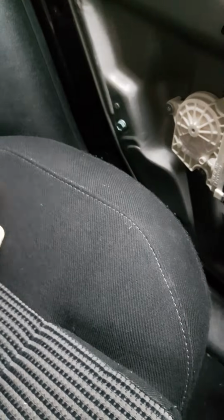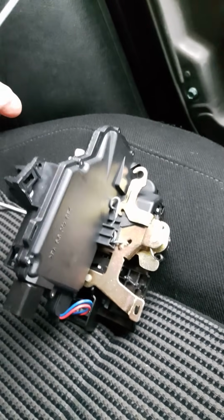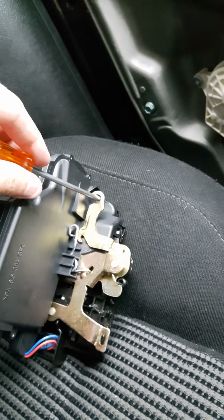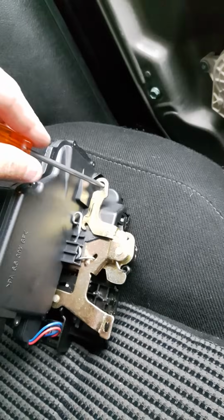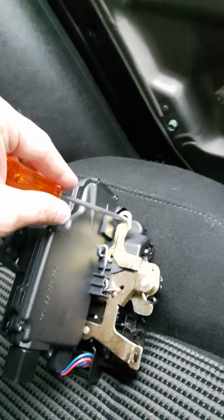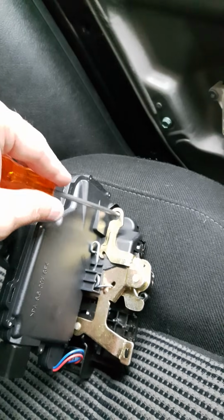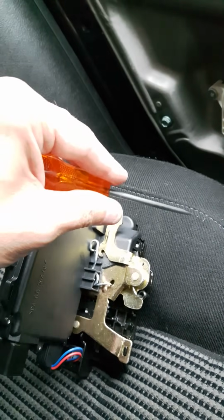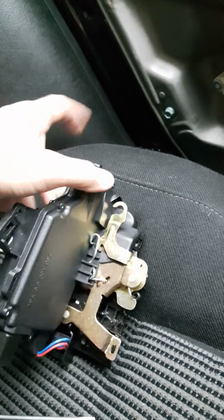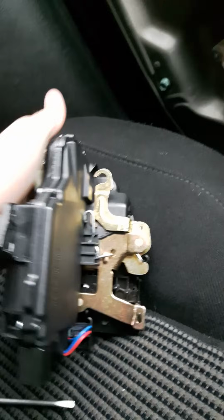Right, on the back, this is the bit that I guess you'd be able to access if you got your hand up inside. This hook here, and there are other clips on YouTube where you can take off the door handle, or the small block to the right of the door handle if it's your rear near side door, and you can access this. So if you got in with a small hook, you could open up a hole, see this bit, and then pull this to the right. Oops, pull this to the right, and that's activating the lock as such.